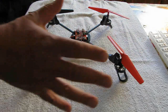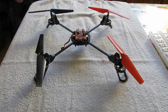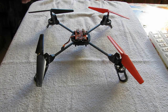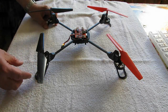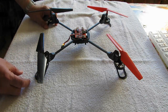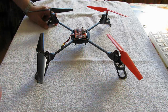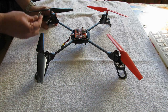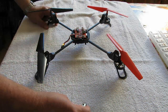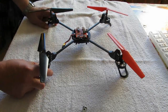To change the motor, the first thing you need to do is remove the canopy if you still have it attached to your quadcopter — I'll include a link in this video to show how to do that. After you remove the canopy, something you really need to pay attention to is the difference between clockwise and counterclockwise motors and how they relate to the quadcopter — specifically the V262.